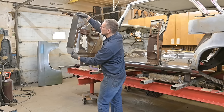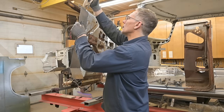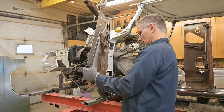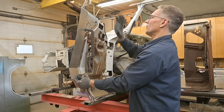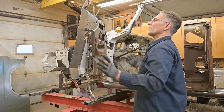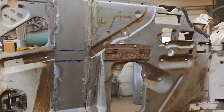Okay, these are looking good. That will blend in — we can clamp this in place. We need to create a little bit of an offset here which will pull this material up. Before I do that though, I'm going to put a few tacks just to hold things in place because it's going to keep sliding around. Aside from that it's looking good. When we form up the new bottom of the door, we'll come right up into here and pick all this up. So we're progressing along quite well — back of the door has been joined to the front, little seam here, we have to finish welding that, the front one's just about there, a little finish work at the bottom.